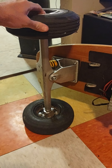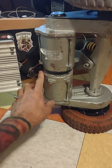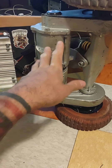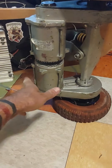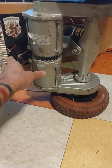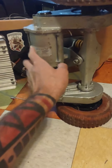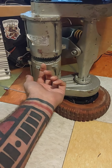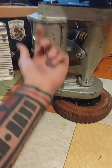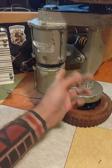I got smaller tires. Something I have never put on YouTube: I have taken apart these motors and cleaned the brushes out — they were disgusting. Awful. I've cleaned them very well, and they are a real bitch to put back together. If any of you guys are watching how to put these motors back together and you're stuck trying to get the brushes aligned with the rotor shaft — you have to use saran wrap, and it works really well.